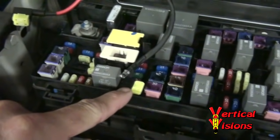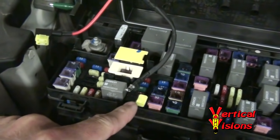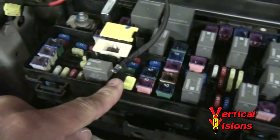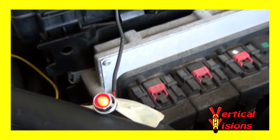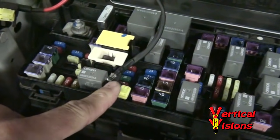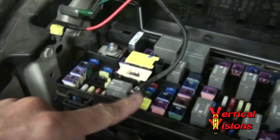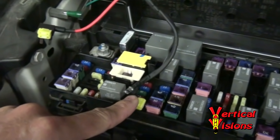This is a good vehicle that's been repaired. So when I start it up, the light's going to remain green and the vehicle is going to start, meaning it's providing power across this circuit — the fuel pump is on and the green LED indicates proper power. But if you have a faulty relay, this LED will flicker on and off, meaning the relay is kicking on and off, or the light may not light at all, indicating that your fuel pump relay is actually not functioning. Or you may find a scenario where your fuel pump is on all the time — while your vehicle is off, you may see this light lit up. We've got a solution to fix that.